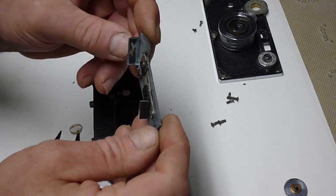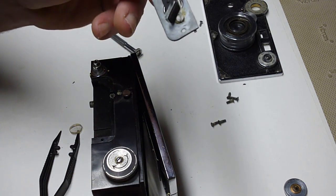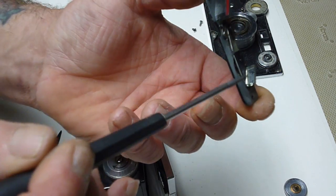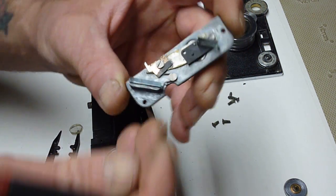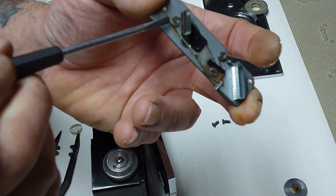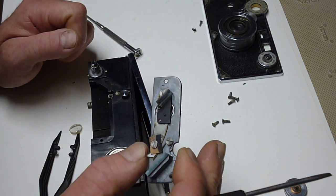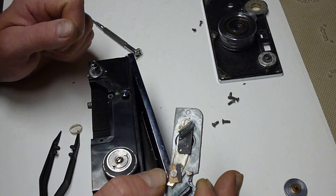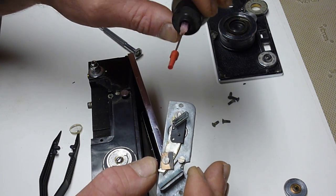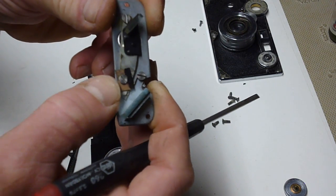This is actually a good one off another camera that I stuck here for demonstration purposes. When you have this in your hand, check the mirrors — make sure they're clean and in place. A Q-tip and some Windex is all I've ever used on these. You've got a couple of pivot points, one right here and one right here. They'll get gummy from ancient lubricant. A little bit of naphtha or alcohol and a Q-tip will usually clean that up. Then you can put a drop — and I mean only a drop — of this synthetic watch oil right there and right there.